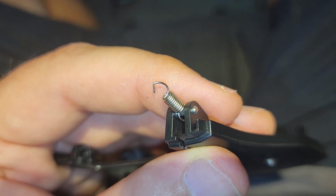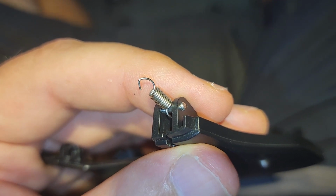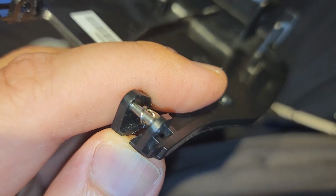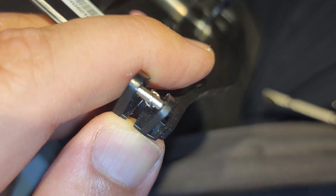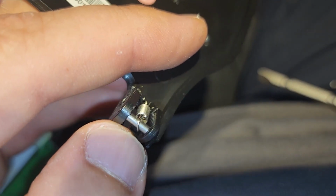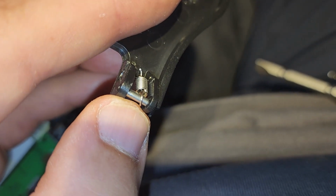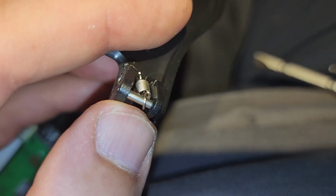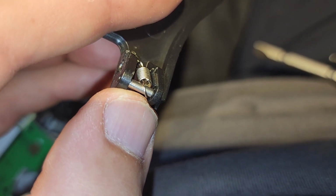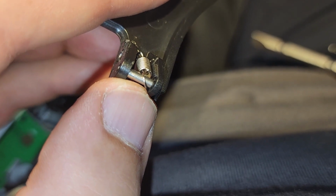I think what I'm going to try to do is get the spring off the door, fix it to that other mechanism, and then try to get the spring reattached to the door. Showing you the approach I'm doing, I'm now spreading apart this plastic to get that pin out, and I'm going to slip the spring over the pin because I think it'll be harder to get the shape of the spring end to reform. So I'm now going to slip that over that, and then I'm going to worry about getting this back to the mechanism, and we'll see what luck we have getting it in reverse.